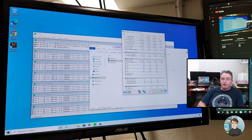In situations like this, if it turns out it doesn't blue screen with this other solid-state drive and other copy of Windows, I'm more along the lines of thinking, especially on a gaming computer, which is really for the most part just a bunch of games you have to reinstall. A clean reinstall on the client's solid state drive, making sure we back up his files first, and then reloading drivers and reloading games is the correct way to do it, by my way of thinking. Because let's say we go through the process of driver cleanup, and maybe it stops the blue screens. There may be other problems in the copy of Windows that we don't fix, as opposed to a clean install, all fresh, good to go kind of way of thinking about it.